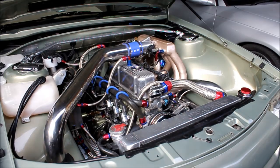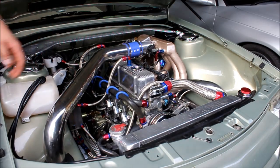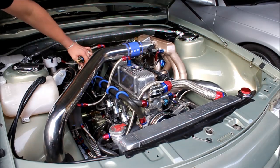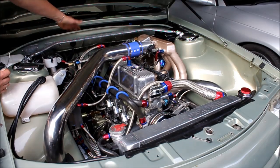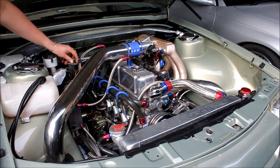It is idling a little bit higher at the moment — I haven't finished the auxiliary air valve yet. We've basically just got the hose that runs the auxiliary air just sort of sitting out here. I'll put my finger over it and drop it back down to about where it should be. The valve's going to sit up behind the firewall so it's going to be all nice and neat.